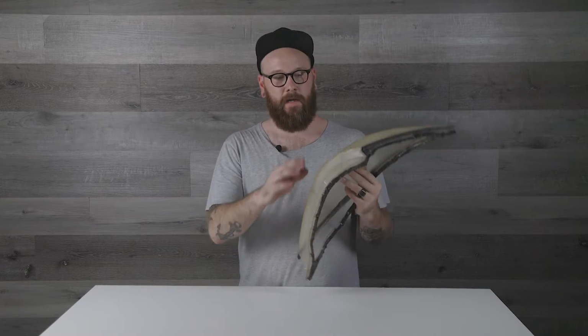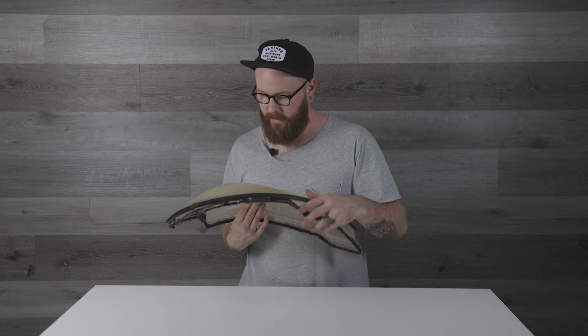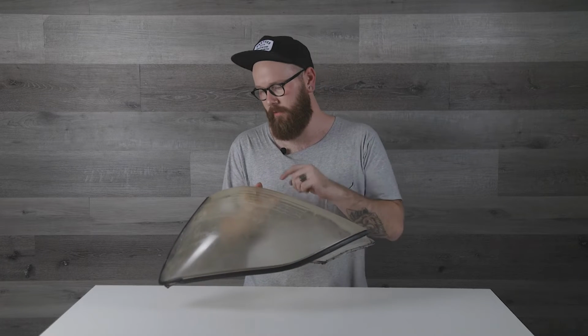We're gonna start by sealing up any of the cracks that are going all the way through the plastic. And so we'll open those up just really gently, and I'm gonna put a little bit of super glue in there just to help seal it. And then we're gonna start sanding. I'm gonna start at probably 220 and sand until I get most of these surface spider cracks out. If you take your time, you should be able to get most of them out. This lens is actually pretty thick, and so it gives you a little bit to sand through. Obviously, those cracks that go all the way through the plastic are there for good. But once we get most of those out with 220, then we'll start working our way up with the grits, all the way to probably about a 3,000 wet sand. And then we'll use our restoration kit with the ceramic coating, and they will be pristine.